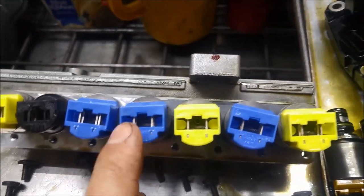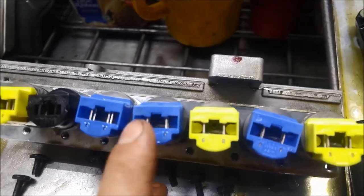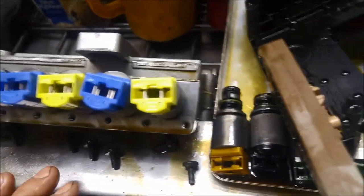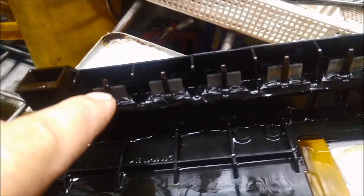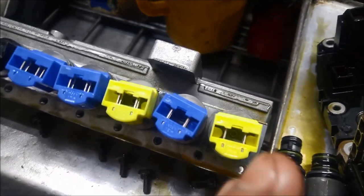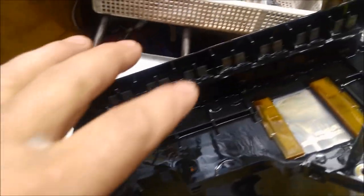I've matched up the solenoids — they actually came in blue instead of the green color, so whether that's stained from the oil I'm not sure. Just make sure you order the right ones for this particular transmission. You can see those little contacts — make a visual inspection to ensure they're not oxidized, corroded, or bent out of shape. Now I'm going to push all these in; they have to be 90 degrees to the valve body.